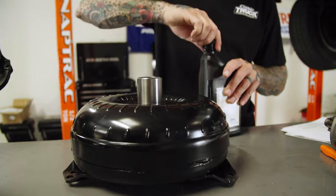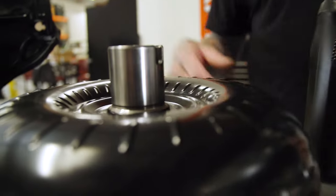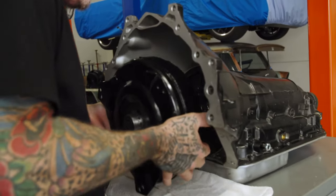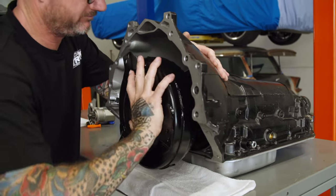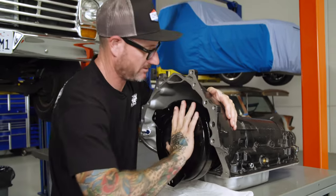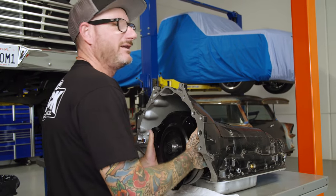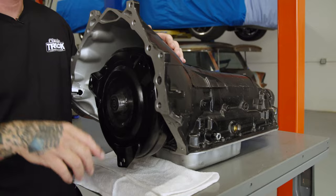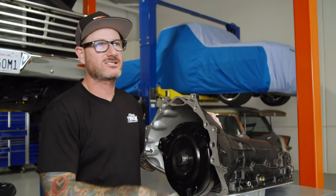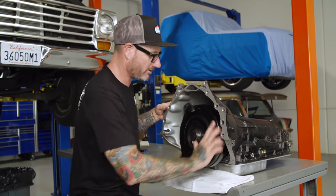We're going to put the converter in the transmission. Before that we're going to put a few quarts of oil in the converter, make sure we lube the outer ring up, and then put it in. These converters take three steps to get in there - it's usually this last one that's sometimes a pain - one, two, three, and we're in. The last click is the converter engaging in the pump. I've seen people where they haven't engaged it all the way in, put the transmission in, and the converter was jammed up against the flywheel. Somehow they got it turned, put the bolts in, drove it down the street, and broke the pump. We are all the way in and good to go.